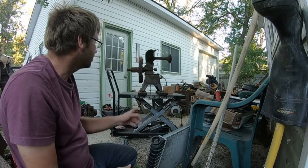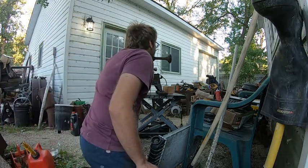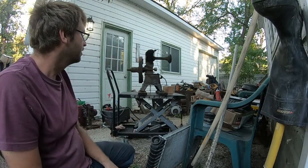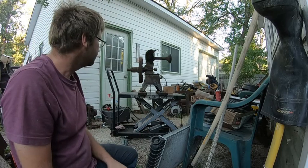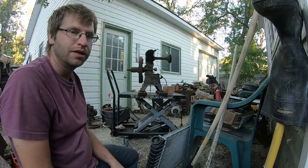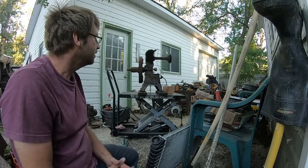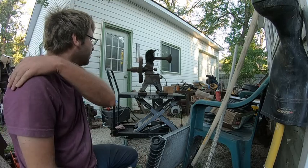I'm going to put another clamp on this side here, and I'll probably let it run for a little bit longer. The fins have been starting to get hot here. But yeah, when I was first going, it had a little choke. It seemed to like basically almost no choke. And like I said, I have the idle valve turned at one turn. So maybe I can back that in a bit.